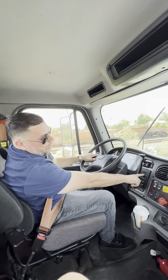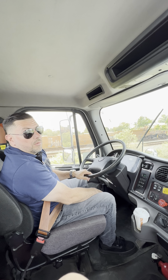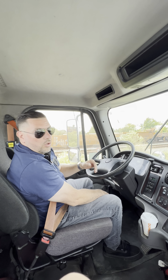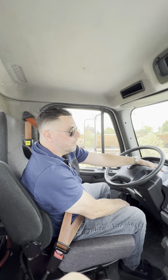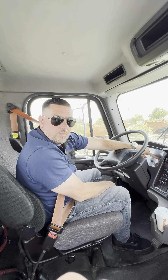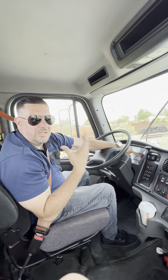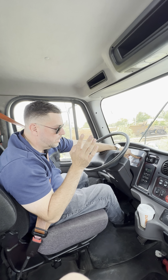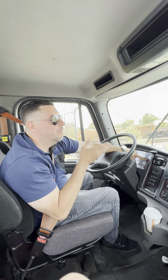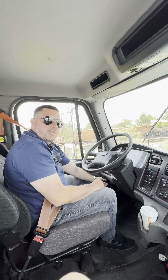Make sure that the truck is also in neutral, which is N. Look at your air pressure. In this case it's already low. If it was almost at max, you would tell the examiner you're going to lower it down a little bit to build it up. But you should indicate now as well that the pressure is already low, so you're going to turn on the vehicle to build up the air pressure. Always point out to the examiner where the pressure's at. If it's full, fan it down a little bit. If it's not full, just tell the examiner the pressure is already low.